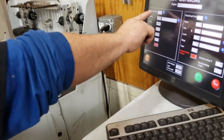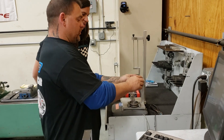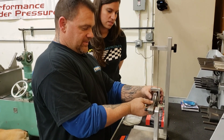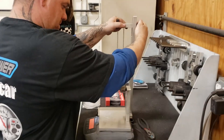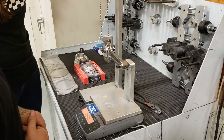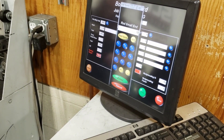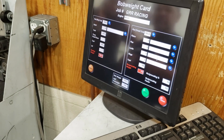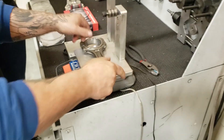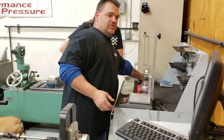So if we take that number and subtract it, we will have our small end weight. Or we can switch the rod around onto this side, bring it back up, and weigh it directly. Make sure it's nice and straight on the scale. The small end reads 188 grams. So if you add the 188 and the 454, you should have the total rod weight. Not brain surgery.